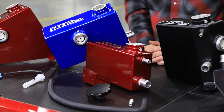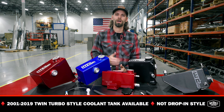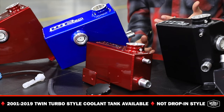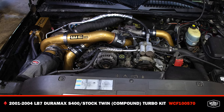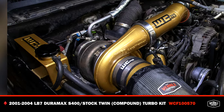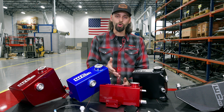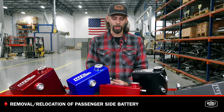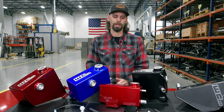This tank here in the center — the candy red, much smaller in size — that one is our twin-turbo-style tank for 01 to 2019 models. These are not a drop-in-style replacement tank. The twin-turbo-style tank is manufactured for the DIY builders, guys that are looking to build a custom turbo setup, compound turbo applications, or racing applications. These tanks are much smaller and more compact in size and sit closer to the passenger-side fender, allowing more room for larger and additional turbochargers. They do, in most cases, require relocation or removal of your passenger-side battery, as well as rerouting of other OEM-style components. So if you're looking to replace your OEM tank in the OEM location, make sure you're getting the OEM-style tank and not the twin-turbo-style tank.